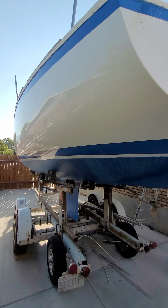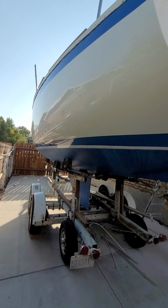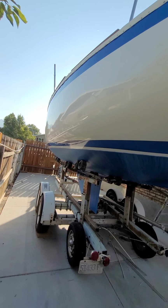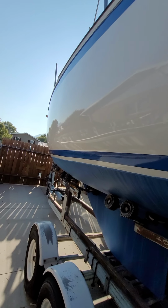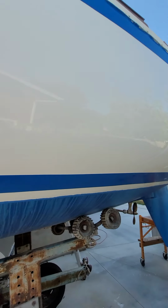Or if you try to put your second coat on and you do your special brush thinner solvent wipe before you apply it, you can literally have the paint curl up on you. But after 3 days, you don't get that. So waiting is king. It's taken me almost a month to paint this boat because of it, which kind of sucks, but it's not a two part paint. So what do you do?